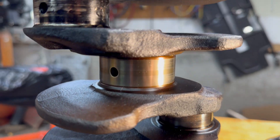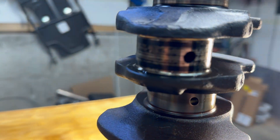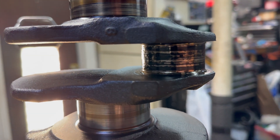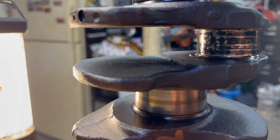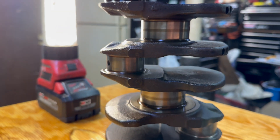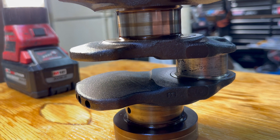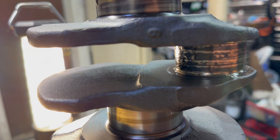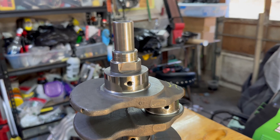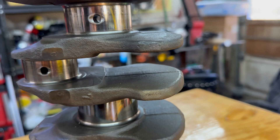Now what usually causes something like this is a lack of oil. You would run out of oil at whatever RPM and it would just start eating itself, and I'm pretty confident that is what happened here because the D16 Y8 oil pump is also a known failure point. We're going to talk a whole lot more about these oil pumps here in a little while, but first let's talk about what we're going to be replacing this crankshaft with. As you can see on the factory Y8 crankshaft, they only have one oil hole per journal for the main journals and for the rod journals. Now if you look over here at our new crankshaft, this is a D16 Z6 crankshaft, fresh from the machine shop where they were able to polish this thing up and make it look brand new.